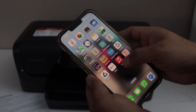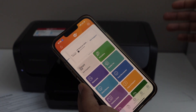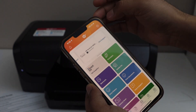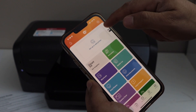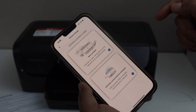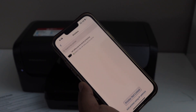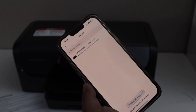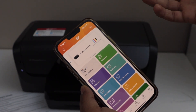Close this window and open the HP Smart app — you can download it from the app store. In this app we have to add this printer. Click on the plus button on the top or select the setup or add printer option. Go to the second option, already connected to network, and select HP OfficeJet Pro 8210.